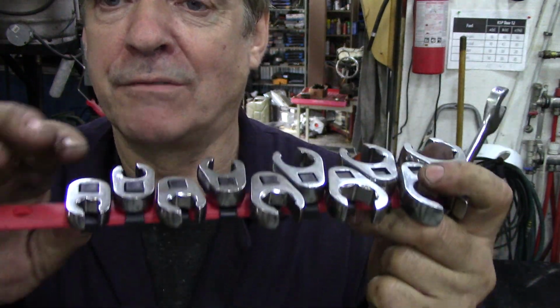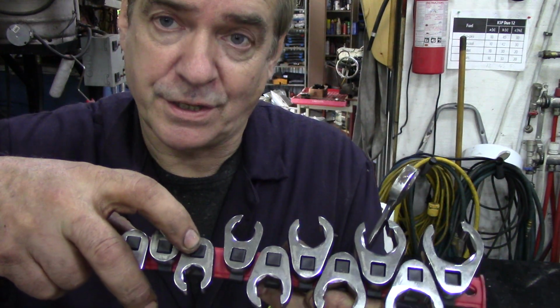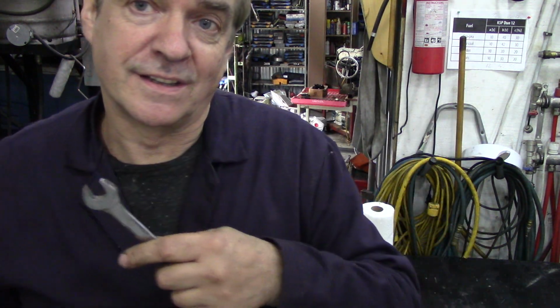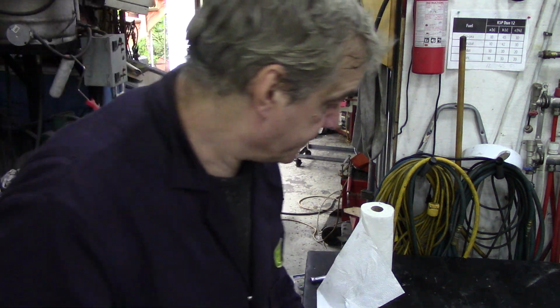I've had ones that have been really thin and they just spin round and open up, but these have been really good. And if you want to get the pipes off your power steering box, for example, if you're feeling really brave, you can put a 3/8 extension bar in there and go straight down instead of going on the side, because there's very limited room. Discos and Range Rovers have bags of room because the wing's in a different place. But Defenders, set of them.